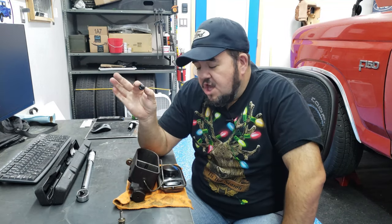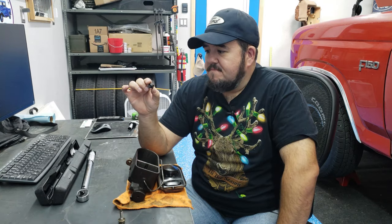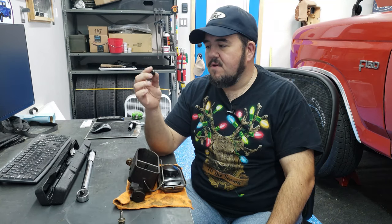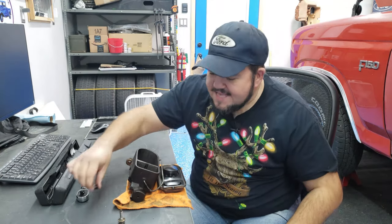Now, I know you're going to tell me that I'm a dumbass because I should have felt that I was applying way more than 5 foot-pounds. But you know what? I was like, well, this thing's got to break at some point, right? And this is a good tough bolt. I mean, this thing should break, the clicker should click way before I ever get to the point of doing any real damage to this thing. No, no. So I sheared the head of this bolt off inside the knuckle.